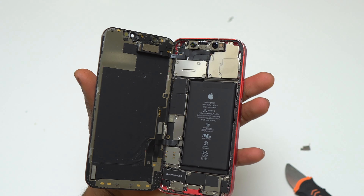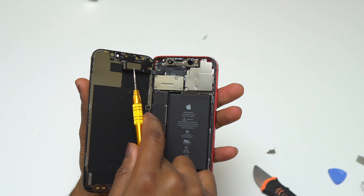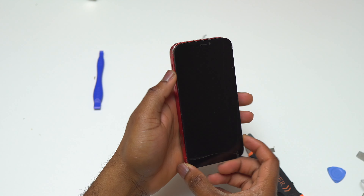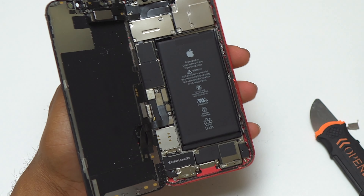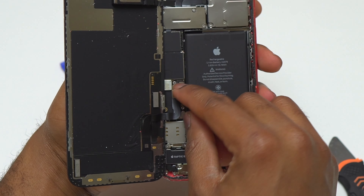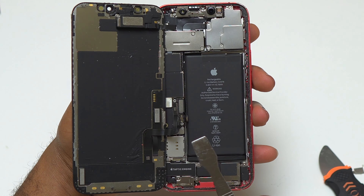After having an opening between the iPhone and the body of the device, I ran one of my guitar picks on all four corners and was able to separate the screen from the body. Also, while inserting your tool between the screen and the body, make sure you do not insert the guitar pick far inside — the left side of the iPhone 12 is where all the flex cables are, and you risk damaging them.